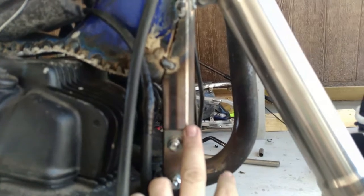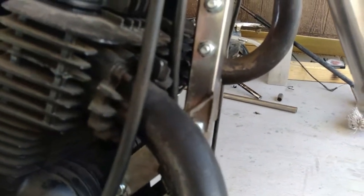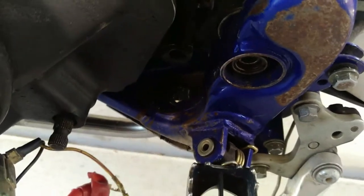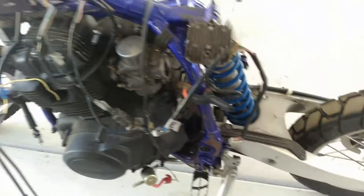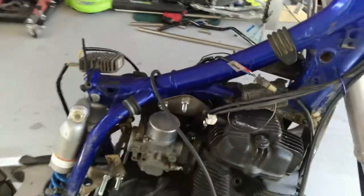As you can tell from the discoloration, then here on the bottom - because we want this to be as easy to get off as possible - with those two pieces of square stock we drilled holes in them to match these and bolted through them. So this part of the pipe all the way down, the motor mounts can come off. There's also a belly pan to protect the bottom of the engine with bolts in here on each side. That entire belly pan is going to come off so the engine can come out, but what we discovered is after putting it in, you don't even need to remove it - it just makes it that much easier.